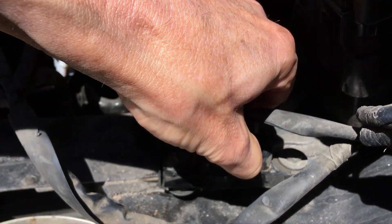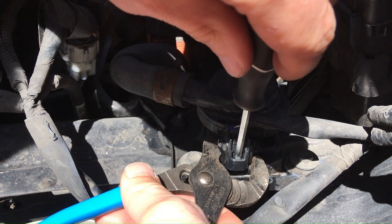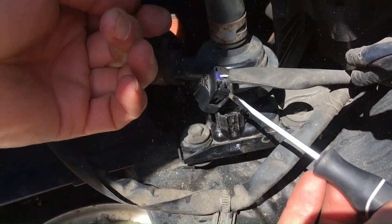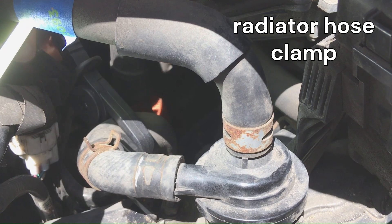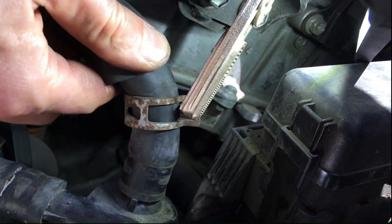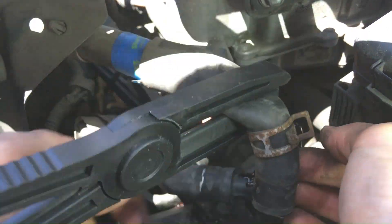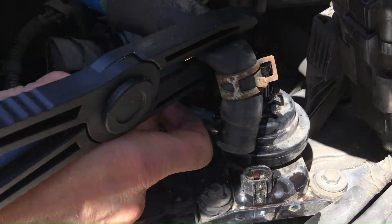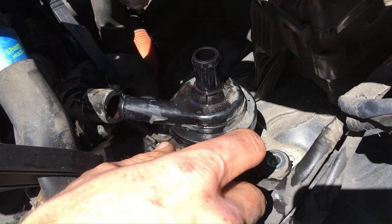This electrical connector was very hard to get off. I tried to pinch it and pull, tried to push in the tab and use pliers and yank it up, and I couldn't. Then I realized the tab actually needs to be pulled outward and then lift up — and that was pretty simple. Get some hose clamps and pinch them out of the way, then use a radiator clamp — those are really handy, I got those at Harbor Freight. They basically pinch the radiator hose so it doesn't leak out while you're doing the procedure. I'm doing it on the top hose, which I put a piece of blue tape around so I wouldn't mix up the two. It's much better to do this while the pump is still screwed into the car so you're not dealing with it flopping around. These are attached by three 10 millimeter bolts, which you just take off, and then boom — the pump is off and pops out.